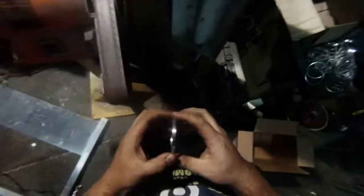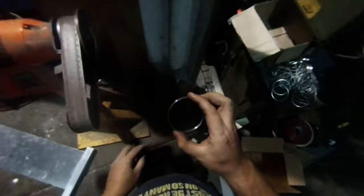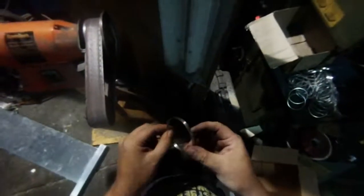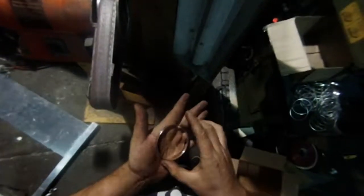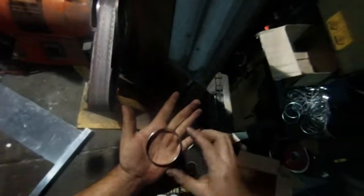So this is my first job for the night. On my EL brake kits, I use a Ford rotor, and the Ford rotor has a larger ID than a Nissan rotor. So to take up the difference, I machine out these aluminium hub rings, so they slip inside the rotor and locate on the axle. So the EL rotor is always centered, otherwise it might wander off.